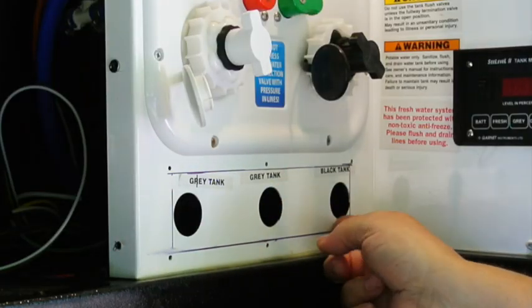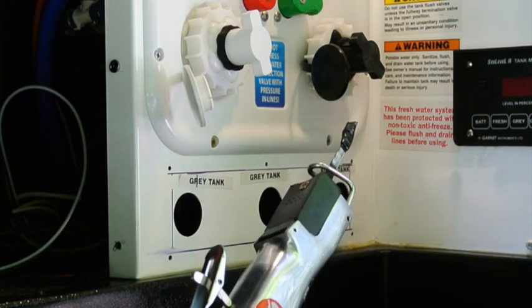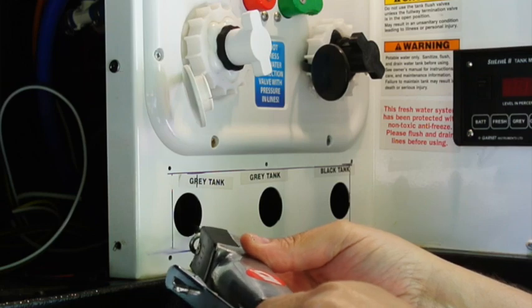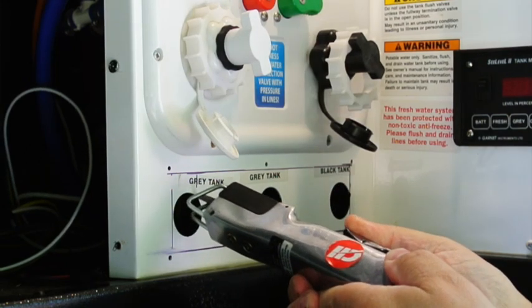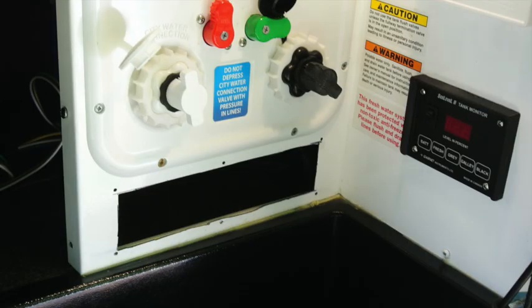Now is the time to cut the square out behind where the panel's going to go. Surprisingly, this stuff can be pretty tough to cut. And I've tried all kinds of different tools, and the one that works the best is this. This is a pneumatic reciprocating saw. And I put a little piece of tape on the end so when we're sawing it, and it's going to kick back, when it kicks back, then we're not going to bang against this, hopefully, and mar it. And I've really not gone beyond the point of no return by cutting that out, because I can always build a new front panel if I ever want to put the original valve back in.